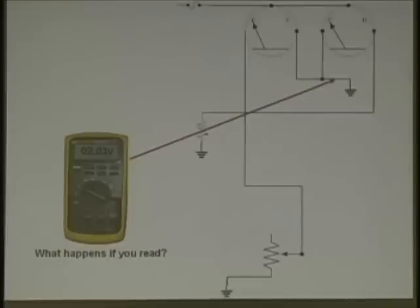Okay. Now, let's say you had this reading right there. What is the customer complaint? Both gauges may have an issue. Why? Hey, that's a lot of voltage to be dropping on something, right? So you may want to write that down next to your 2.3. A ground problem there is an issue on both gauges. Both gauges could be inaccurate.